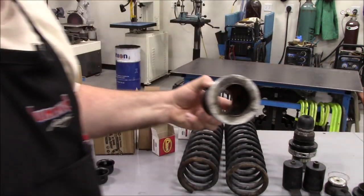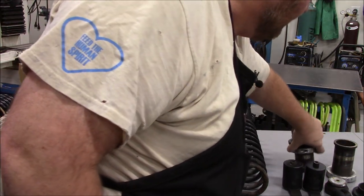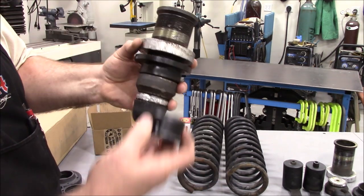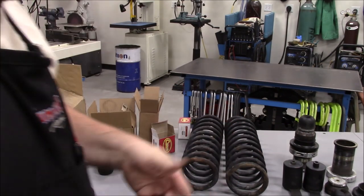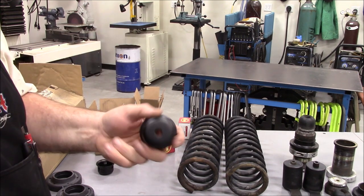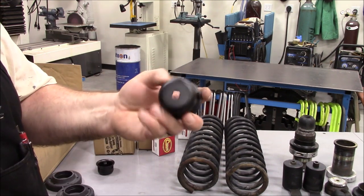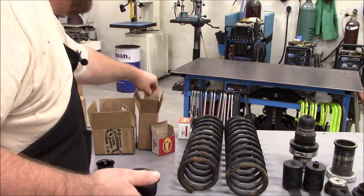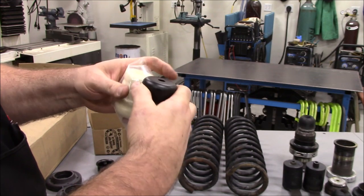However, when you put these JKS ACOS adjustable coilover spacers on, you basically, in essence, have to cut the jounce cup off of the tube, which is what I had done. They say these are irreversible. But what I've done is I've bought the TJ, so that'd be a 1997 through 2006 Wrangler, TJ or LJ, replacement for them because they bolt on. They're the same basic cup, only on the JKs they're welded on, and the TJs they're bolted on, and these will accept the factory JK jounce stops. That would sit up in like about like so.